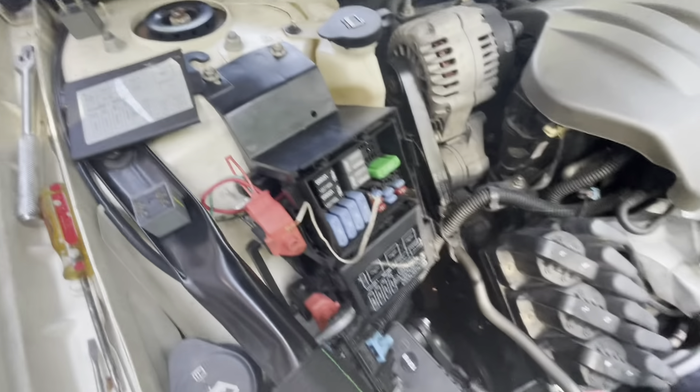I'm not getting a security light here, but something is still going on with the security. How do I know? Because when I go into my scanner and pull up live data, there's a lockout timer. The car is on — key off, then key on.